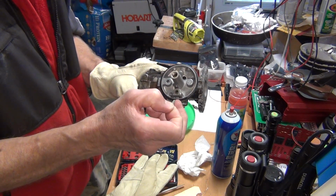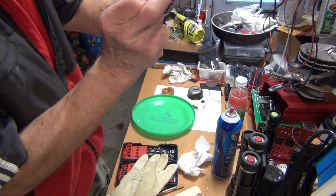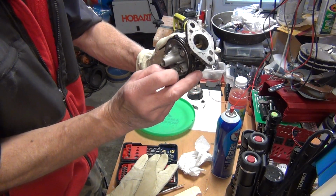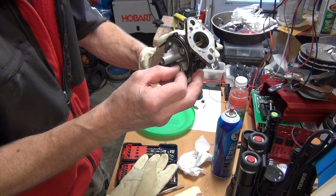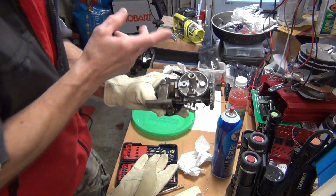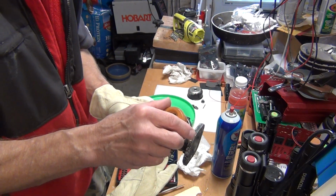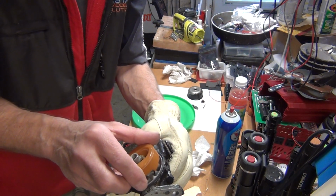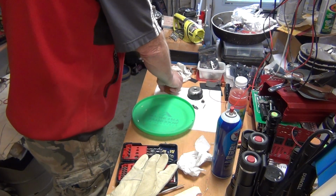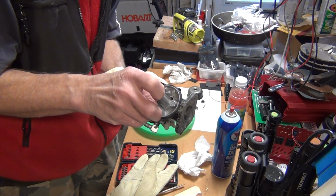to open this needle, the pressure actually opening the needle, so the needle would be kind of in free fall from the opening. But in this case the needle is getting stuck in there. When I push on it kind of hard, it gets stuck, and it doesn't let gas go through. Now what happened here, when the carb was full and this was pushing on the needle, when it closes like that, the needle got stuck inside, and that's why that tractor wasn't running. It was not because the carburetor was dirty, it was because the needle was stuck inside here and didn't let the gas go through.